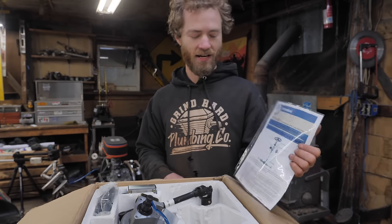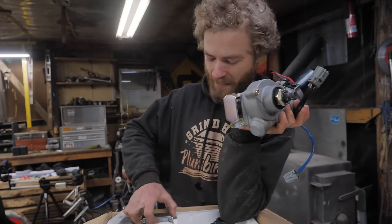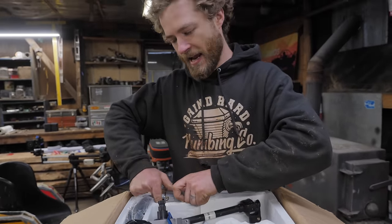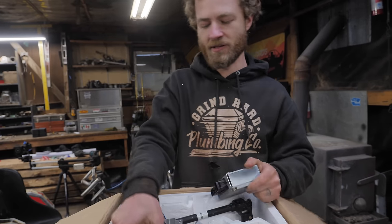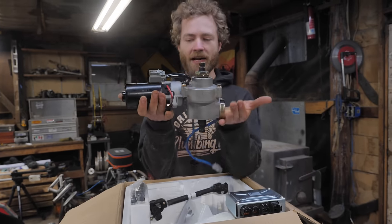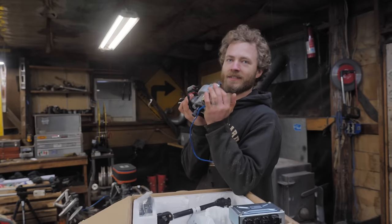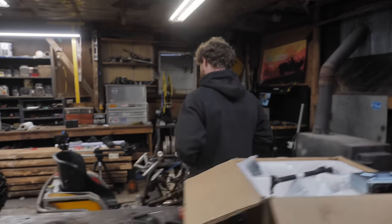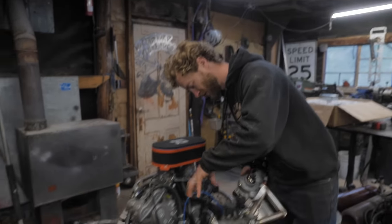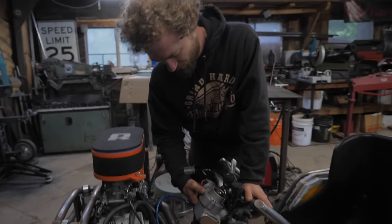Colonel Sanders is getting electronic power steering. It has a computer that controls it all. It senses the torque that you put in with your hands on the steering wheel and then amplifies that with this motor and gives you power steering. As far as power steering goes, it's extremely compact because that's the entire system right there. But as far as putting it in a Power Wheels goes, rather large. So the idea is, unfortunately, chop off this whole steering column and then mount this in its place.